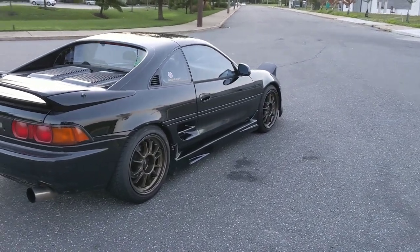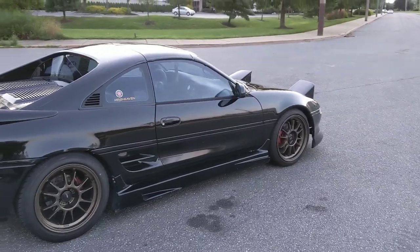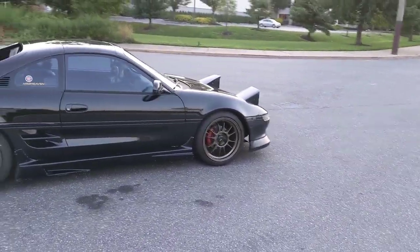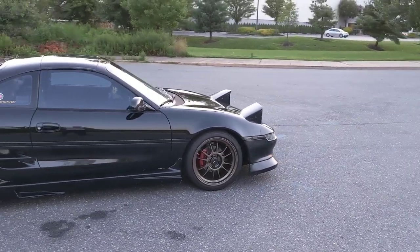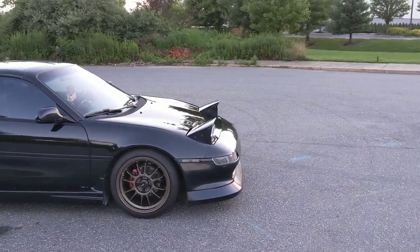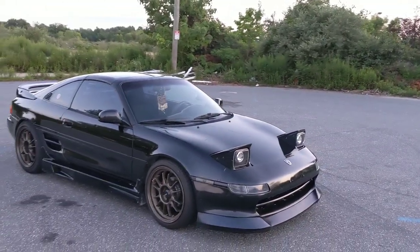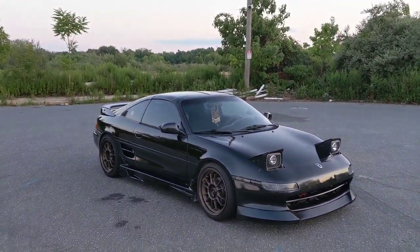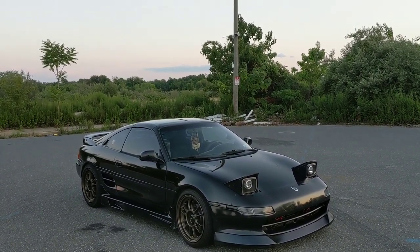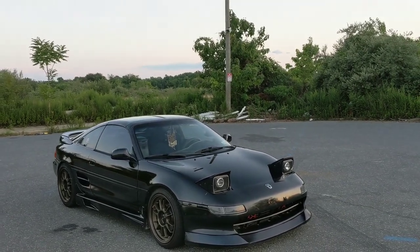I didn't want to buy a factory knock sensor. I know it sounds like, oh, buy the factory knock sensor, but I saw on ATS's website, ATS is a company that makes MR2 parts and other parts for other cars, like Lotuses and Ferraris, that he made a knock sensor. It's called a GM knock sensor, so it's off of a Corvette or whatever car they take it off of, because they don't give you the part number. They make a pigtail that connects onto the knock sensor. I have a video of it on my channel, but that was my replacement, and it's much stronger.